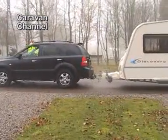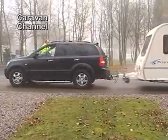Okay, what we're looking at doing this morning is just covering the coupling up of the caravan to a car. Doing it the safest way. And the safest way to stand is back on the left hand side or the near side of the tow bar, just gently leaning against the side of the caravan. And then if there is any problem with the car coming back, the caravan will take a bit of the punch out of it, you won't get injured.